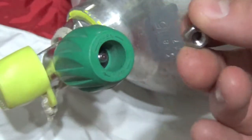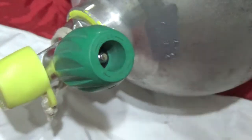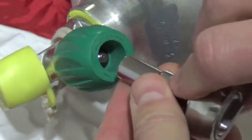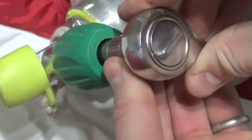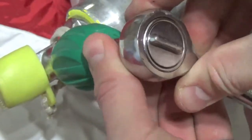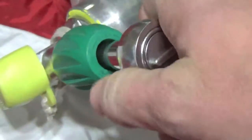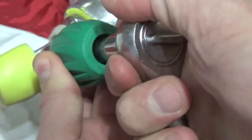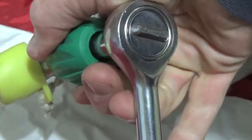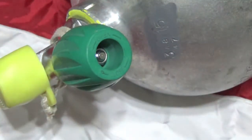It'll sit on there loosely. You're then going to want to replace your nylon nut. Very easy — I slip mine inside the socket that I'm working with and then simply feed it on until it gets tight, and then just give it a slight extra torque to tighten it up. It's a nylon nut, so you shouldn't have any problem with that seating correctly.